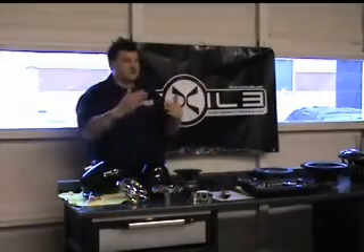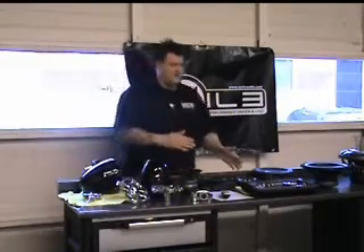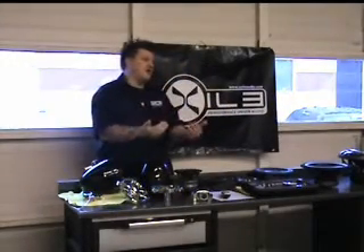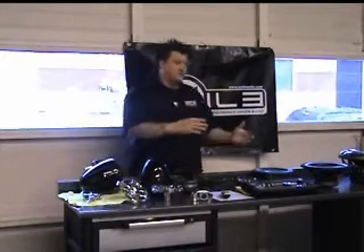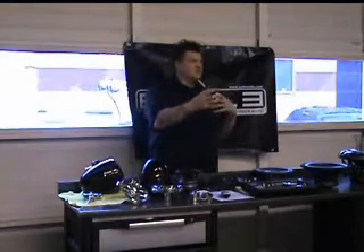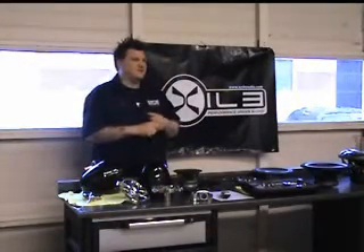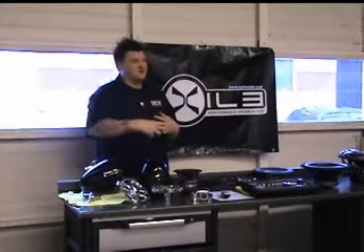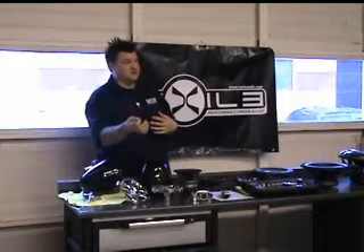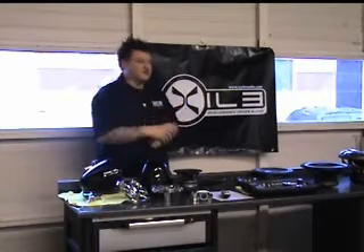What we're talking about with headroom is you want to match an amplifier and head unit so your deck is at three-quarters level, your amplifier isn't cranked — it's turned back some — it's running efficiently, running cooler, but still putting out the power. You also want to look at amplifiers for their RMS power. With iPods being very popular, a lot of content is compressed music, so you've probably noticed turning things up louder. Having some dynamic headroom allows you more flexibility to turn stuff up and down.